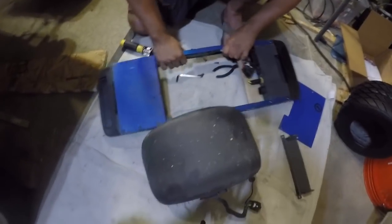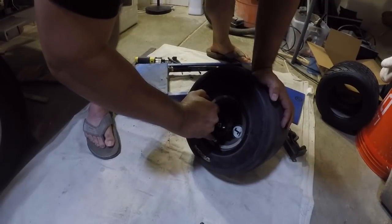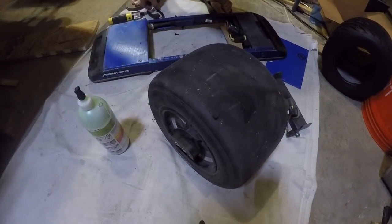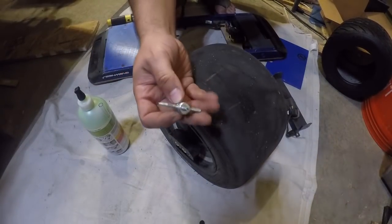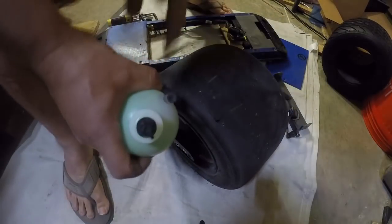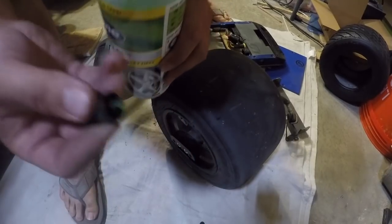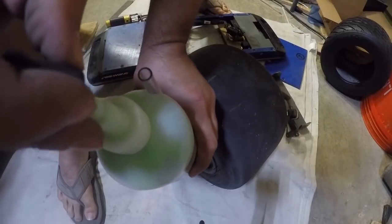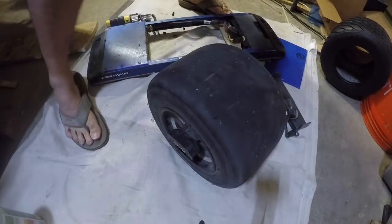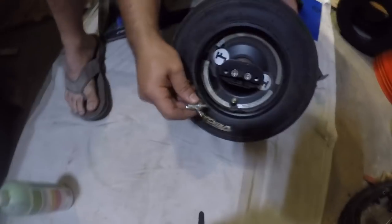I think it's helpful to release all the pressure from inside the tire first, so I'm gonna go ahead and do that now. You can buy this tool for like two dollars at Walmart — this helps you basically unscrew that little piece inside the valve stem. Or if you get slime, it comes with a little piece on the top that does the same thing. I prefer the metal one I bought for two bucks.